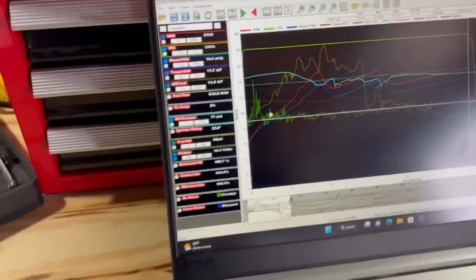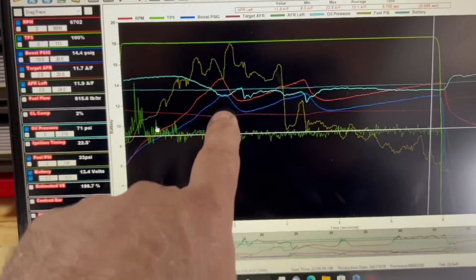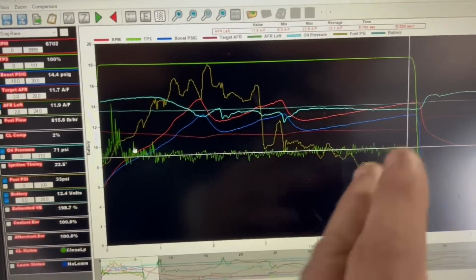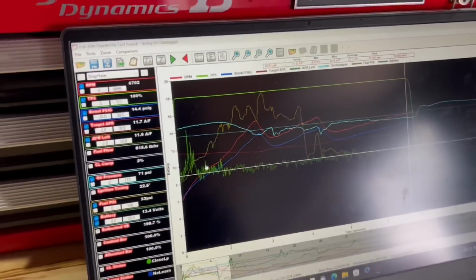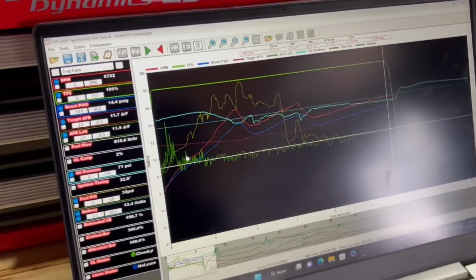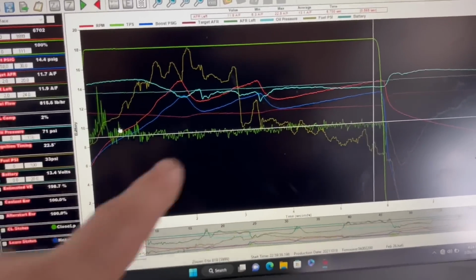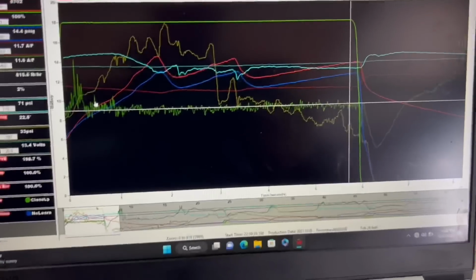So with that big of a cell, we're thinking that this is about the time, this car doesn't have a G meter, but if you think about it, the fuel sloshes back here, and then it starts kind of coming back toward the front. Maybe it's a fuel slosh issue, and it's pulling air from the in-tank pump, the primary pump. And so maybe we're introducing air in there, and that's aerating, and of course you won't have any fuel pressure when that happens.